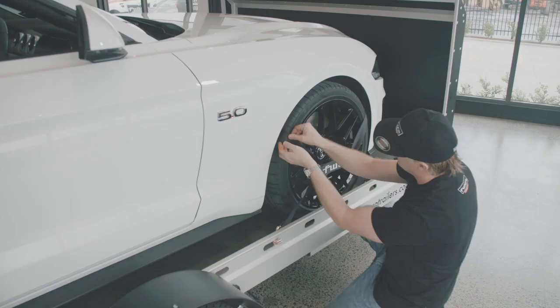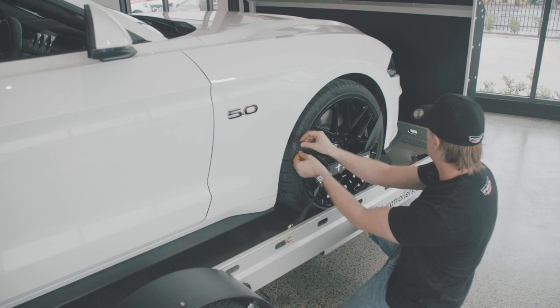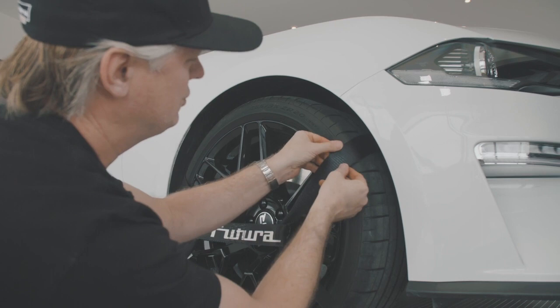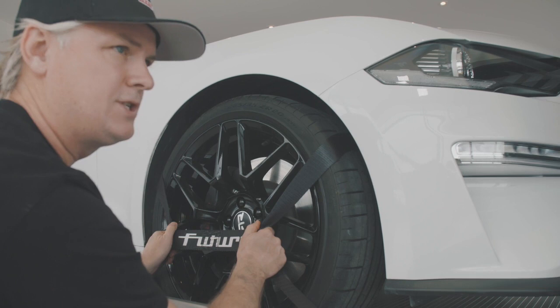If that strap happens to be going flat — which can often happen when you're tying down on a hot tyre and it gets a little sticky — you want to rotate it around so it hasn't got the opportunity to move while you're travelling. Make sure the tie-down tracks the shortest route possible up on an angle, continuing across to the top of the tyre. That ensures it doesn't move when travelling. If you have it wrong, it's likely to slip down, the tie-downs loosen off, and you'll have to keep checking and tightening them. If you get it correct first time, these will not let go.